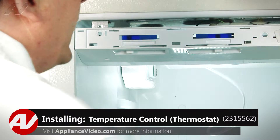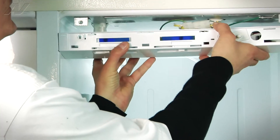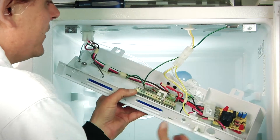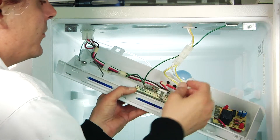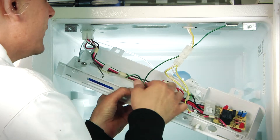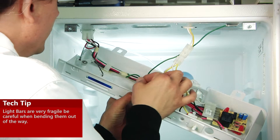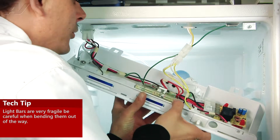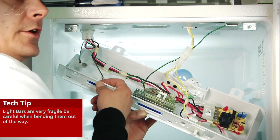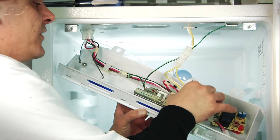We can now come back up to the very front and to the control housing and we can drop this down some. Once we've got it dropped down, we can now see our thermostat. This is where you may want to take a picture of it to make sure it's going back in position how you want it to go. You will see that you have a couple of little light bars that come through. One goes into the black dot here, the other one comes over here to this black dot. This one has to come out to remove the thermostat and it was already out, so we're just going to set it aside.